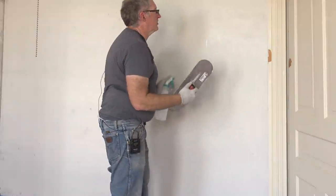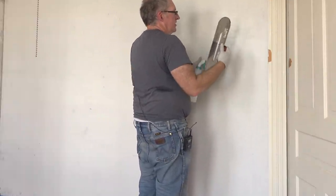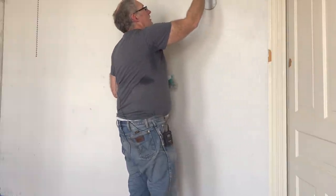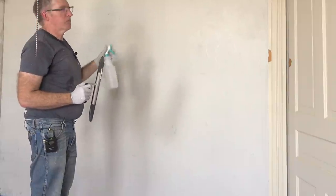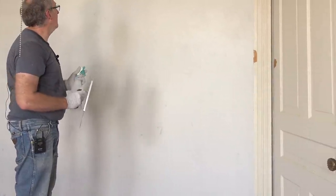And we definitely have some experience with that recently. When we did the base coat, we couldn't really do this to it because we'd be polishing it. And when you polish base coat, the top coat won't stick to it. So we really didn't have much opportunity to work it.